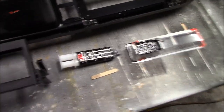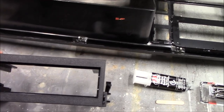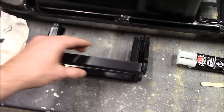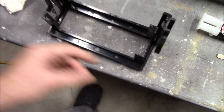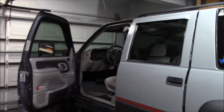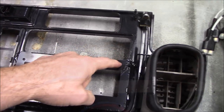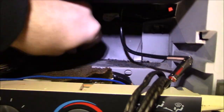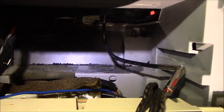I don't like the idea of this just hanging on the dash — I want more support for it. So I'm going to slice this bracket up, maybe cut them off each side, so I can slip the wiring where I need it. I'm also going to cut out some of that plastic there with my plunge saw — there was a rib going between these two. Just this little piece of scrap, hopefully gives me a little more room. Did my best not to dig into the plenum. I know if you put a double DIN in here you have to clearance that stuff.